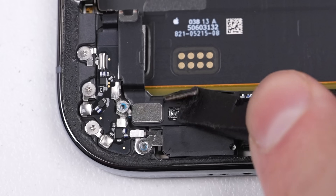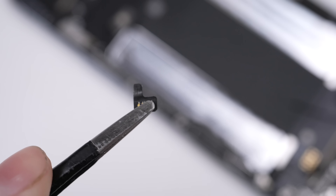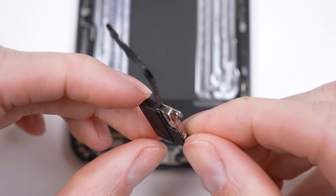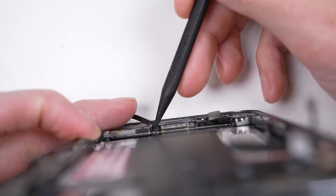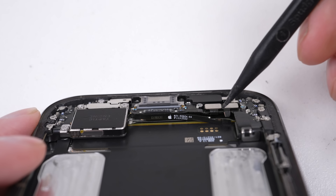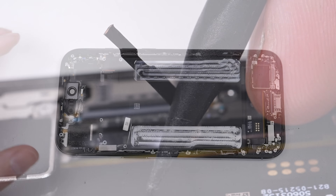Just a slip of my spudger was enough to snap this 0.1mm cable clean off. This being my fifth year of teardowns, this is the first iPhone out of the 12 or so I've purchased that I've damaged something on. I'm just thankful it wasn't a $900 screen cable, but the Taptic engine — Apple's fancy name for a vibrator — probably going to be a $30 part. But what we've learnt is vital repair advice: unplug the leftmost cable first, because the cable next to it has the ability to tear it in half if bent backwards.